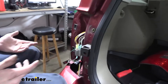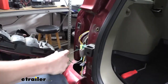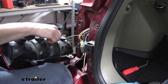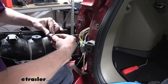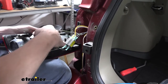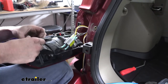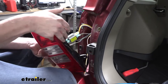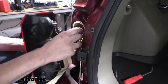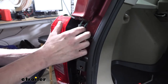So we can now reinstall the taillight assembly on this side. Just grab your assembly and plug your connectors back in — do the lower one first, make sure it clips all the way in, push your lock tab in. Same with the upper — push in the lock tab. And then we can just reinstall our assembly here. This is where you just have to try to find where you can hide these because it's going to be tight back in there.